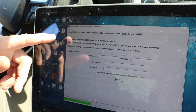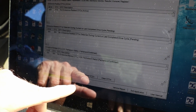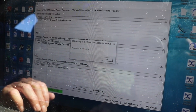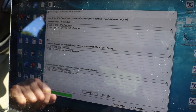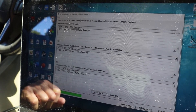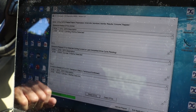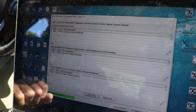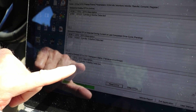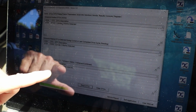Let's go back to diagnostic trouble codes. We have an engine light on, so we're going to read DTCs. Discovery of DTCs complete. This car was running a little rough — it has a cylinder 3 misfire detected. That's a P-code: P0303, diagnostic trouble code. It's pretty consistent, marked as emissions related, with both the pending code and the permanent code confirmed.